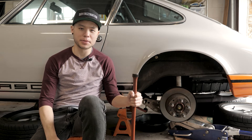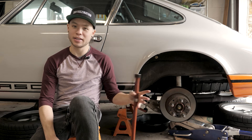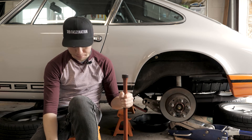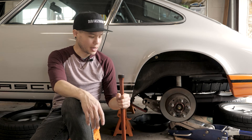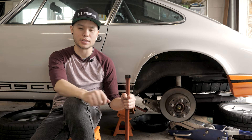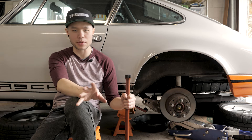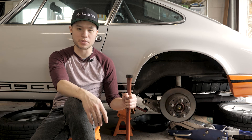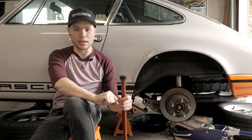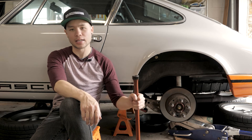This episode of Benny Obscene brought to you by propane torch: if your shit's stuck, light it on fire. We got it out — the spring plate is out, the torsion bar is out! What I ended up doing was going full-on at it for a little bit. Ultimately I had to bust the cover off of the spring plate, hit that with tons and tons of fire, spray some PB Blaster in there, and ultimately took a half-inch extension, whacked it with a big-ass hammer, and eventually it came loose.